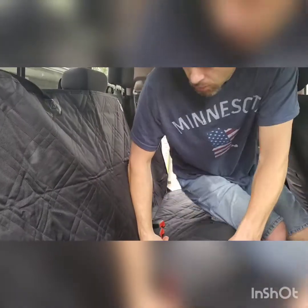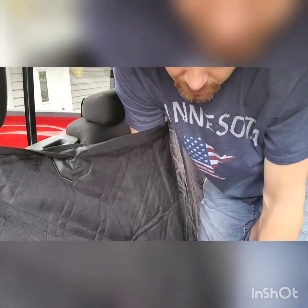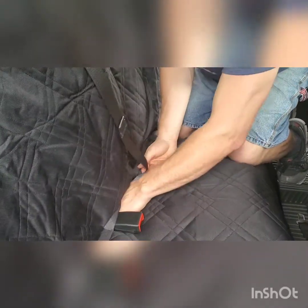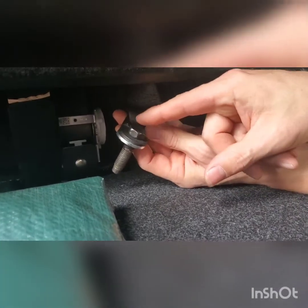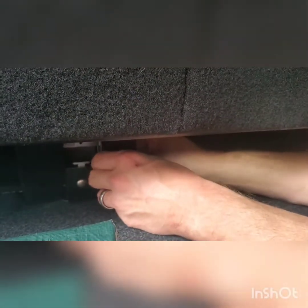Second thing is — where did my center seat belt go? I went underneath the seat to find it. I disconnected my seat belt so that I can fish it through and put it back together. The big seat tips up like that, up out of the way. All I did was come under here and found that it was being held in place with a giant bolt, which happens to be an 18 millimeter. I undid this so that I could fish it through that pocket on the dog seat cover.